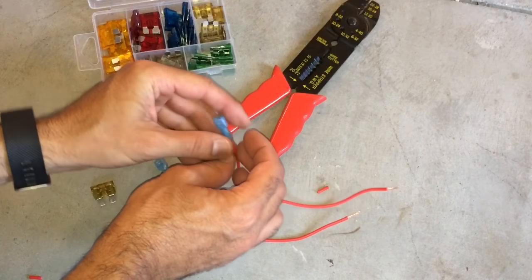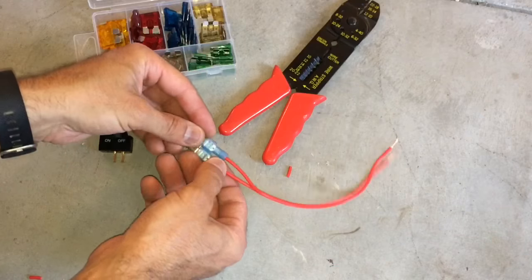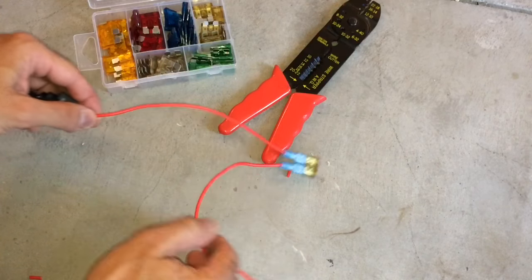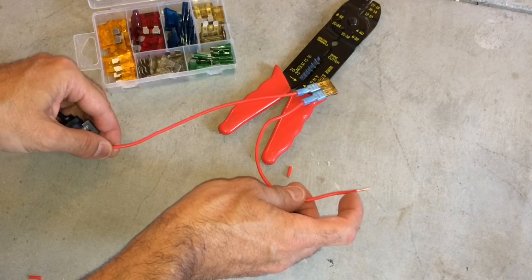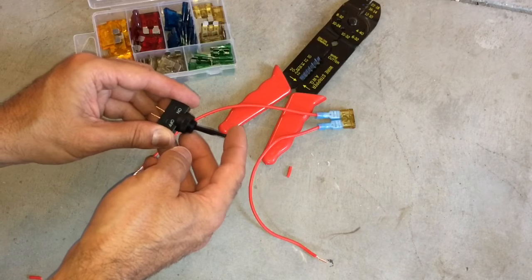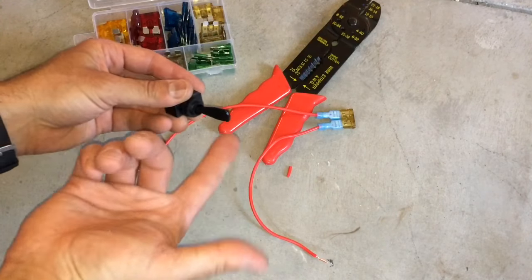These have been completed — I went ahead and put the female connectors on and stripped these two ends. Now we take the fuse and go ahead and wire it up. So now that's connected. We'll put another female connector on this end — that'll slide over one of the pins on the switch. This end will then connect to the 12-volt input of the accessory or device you're powering. Then we'll bring in the straight 12 volts into the other pin. So now we have the 12-volt current coming in — when the switch is turned off or on, we're either turning on the current or cutting it off. It'll pass through the fuse as a safety valve before it hits the device. We'll power it up, connect the ground, make sure it works, mount it to the dash, and that'll wrap this up.